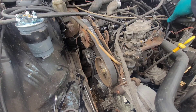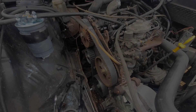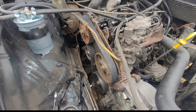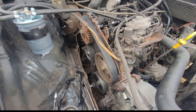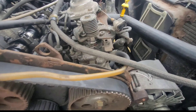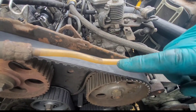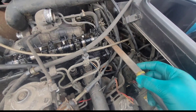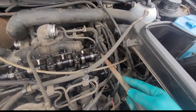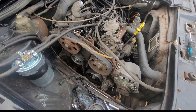Now what we're going to do is rotate the engine. Take special tool number one out, otherwise you're going to snap stuff. Then get a ratchet with a 19mm socket and give the engine two full rotations, then line it back up with the TDC markers to make sure nothing locks up, no horrible noises, and it's nice and smooth. Once we're back at TDC, as you can see our timing mark on the fuel pump is now bang in line with the metal casing. Put special tool number one back in and make sure that lines up - happy days.